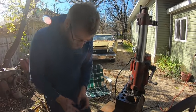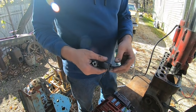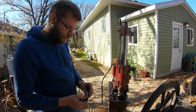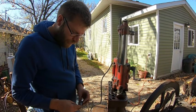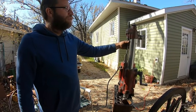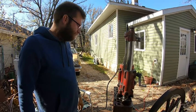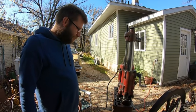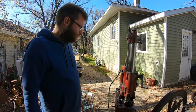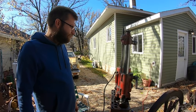We've made up some tools — we've used this for some stationary engines. Here's just out of a piece of an old end mill, just a sleeve trimmer, because we sleeved a couple engines with this guy. I've never bored a car engine out with it — first time using it on a car engine. That's a similar deal for bolting it down. We'll need to put a stop on here — the stop rod was never on here. Since we're going to be sleeving a block, I'm going to put a clamp with a dial indicator so I can go to the same height every time. We'll see if it's straight and round — we used it a couple years ago on small engines and they came out straight and round.